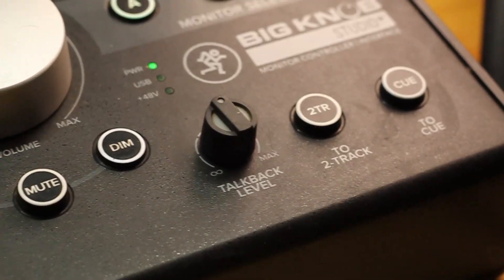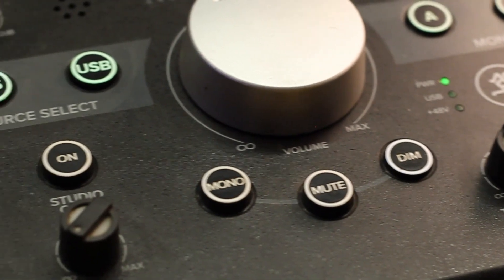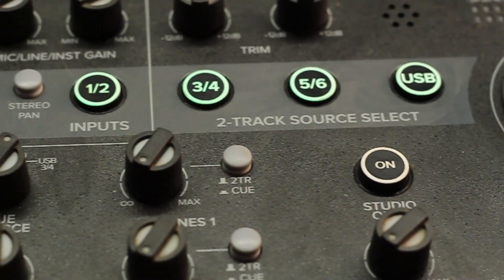An interface is better if you're doing something simple where you just have one or two mic inputs and one set of speaker outputs — say if you're doing a podcast and you just want some good audio. But if you're doing a little bit more, or you have more or less a studio environment where you need to switch different output sources, that's where you're going to have more benefits with a monitor controller, because with a basic interface all you have is just your main level outputs — one set of jacks on the back and a headphone quarter-inch output.